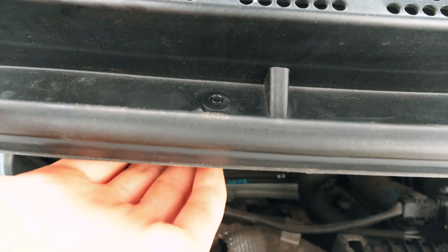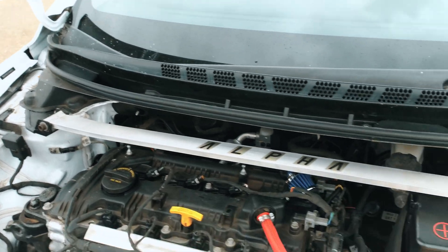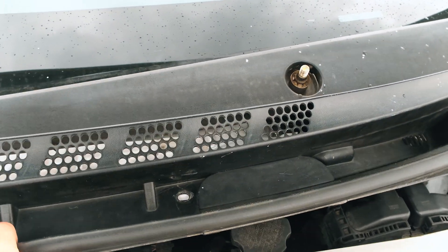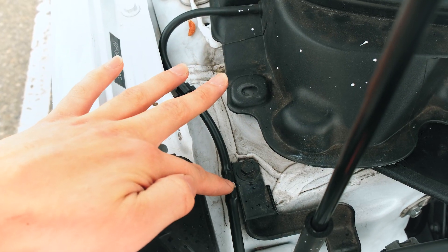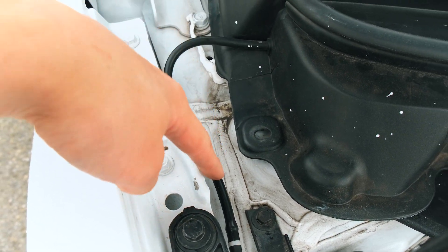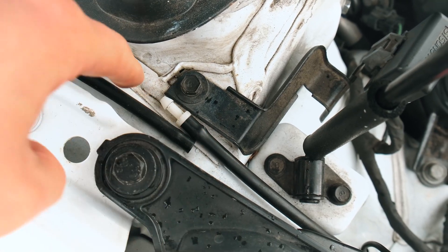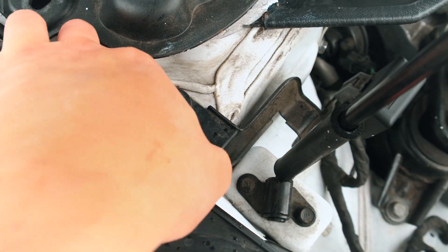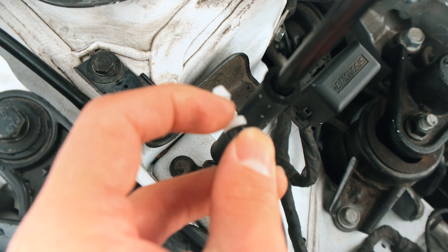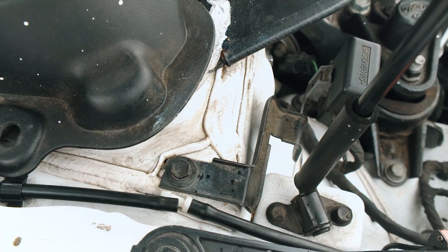A quick tip: when doing the middle ones, hold your hand underneath while doing the press-down-and-pull-out to make sure you don't lose the middle plunger. Once all clips are removed, just slide down and then lift up to get over the two windshield wiper assemblies. If your car has the windshield washer, you're going to need to disconnect it here, pull it through, and that way it can come out with the shroud. I recommend when you put it back on, put a little bit of silicone grease there — that'll make sure removing this assembly later on is easy while still keeping it secure.